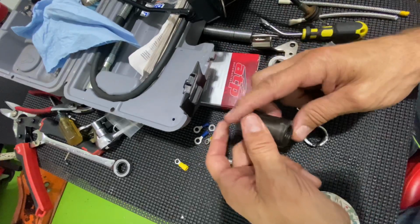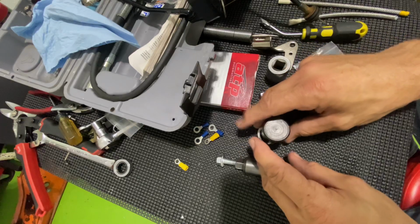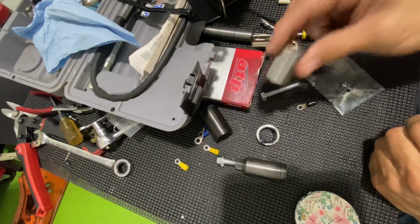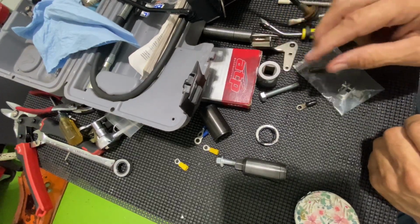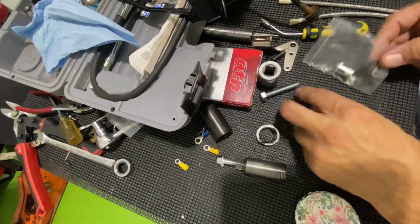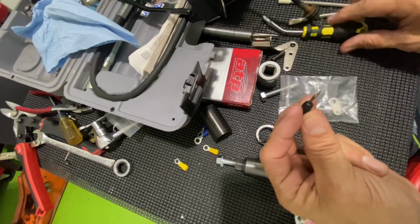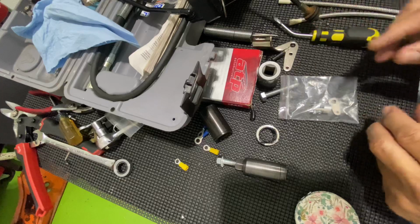And so this is the driver. You're supposed to put the seal on there, put this over the top, and hammer it down. Well, this doesn't fit the shaft either. And so I ended up using a socket. I used that and hammered it down, hammered it into place. And what else do we do? Oh, I ended up replacing this ring terminal from the reverse switch because I slipped so many times with the screwdriver. I ended up breaking this off, so I replaced that quickly.